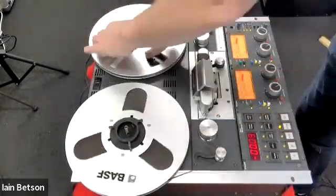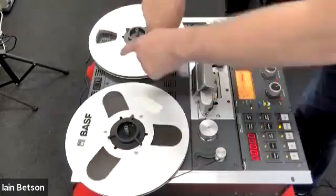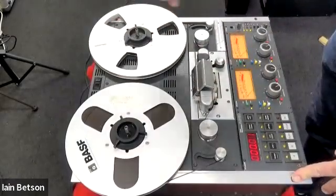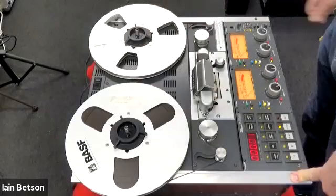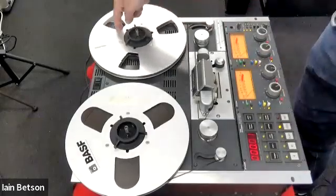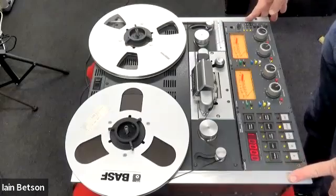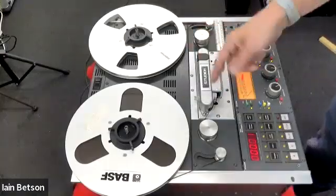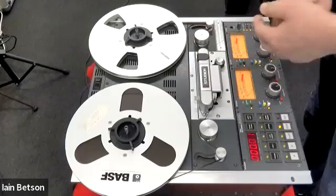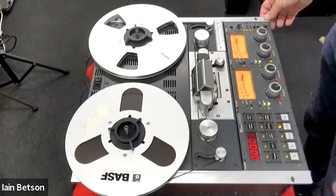Now this is the fun bit — you have to get the knack, two fingers or two hands, and literally turn this until it starts to turn the other reel, i.e. the tape has bitten. Some people do bring a piece of tape out through one of these cutouts, but it looks a bit ragged going around, so I much prefer to catch it underneath and drag it around — that way you know the tape's laced up. If you want the hum shield down you can, but it's not obligatory. So in the short term I'm just going to leave it up.